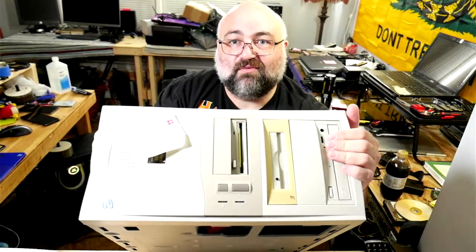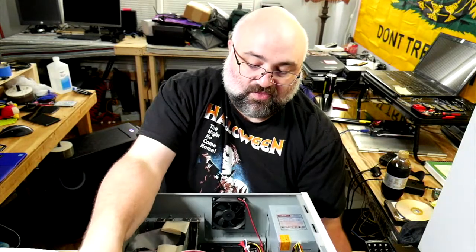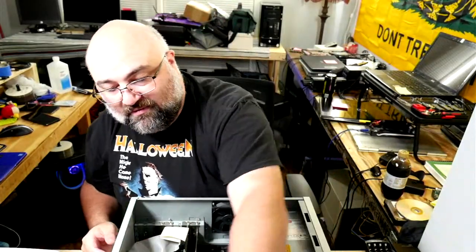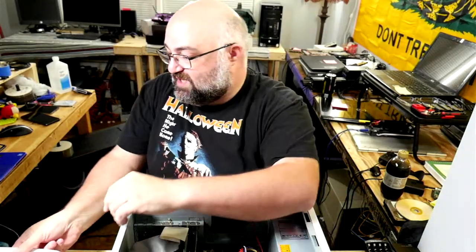Now, originally, the plan, maybe I should cock it up now that I'm talking. Not down. That's not the correct direction, Mr. Panasonic. Let's have a little chat here. There you go, buddy. So, originally, the plan with this was to replace this CD drive with a CD or DVD burner and throw on Nero Burning ROM 5.5, which for some reason I still have from like 2001 or something. And that way the guy could burn discs to get the data off, en masse. Because CDs back in the day, like, what's that thing say on the front? It's like 500 or 320 meg hard drive. A single blank CD is 700 megabytes. It was 650 back then. But you're talking double the size of this hard drive. So if he sticks a zip disk or two in, he can copy them off to a multi-session CD, and it'll be easy as pie.